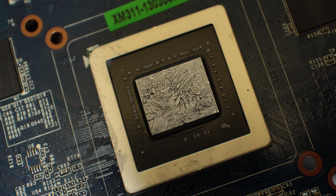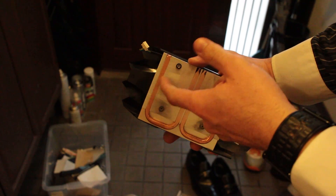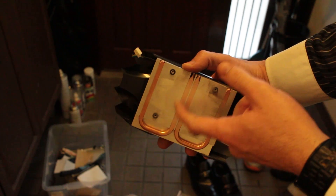I've been a bit of a fan of silicone grease on normal heatsinks, but it did terrible for what it's worth on a die. As for the lapping itself, you guys probably saw the results — it didn't do too well. I was surprised; I thought we would have got a bigger drop, especially on a cooler with really rough grooves. You could see with my fingernail I etched it, and after sanding it was really smooth, yet the temperature drop was probably only half a degree to one degree at best over just the stock rough heatsink.